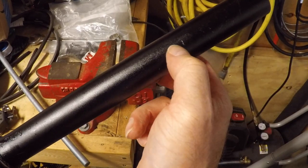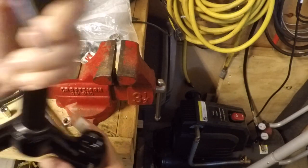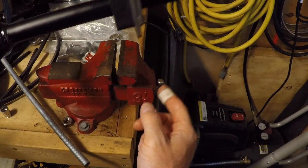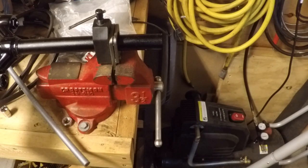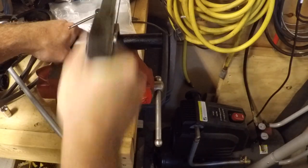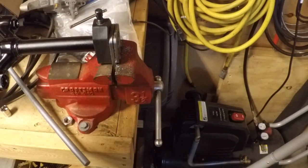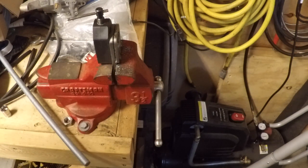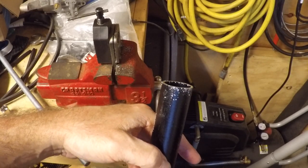Right here is our mark — that's where I'm going to cut. I'm loosening this to slide it down. I've got it in place. You put this end in a vise, so now your fork is well supported, and we're going to cut this baby. All right, that's that — tell me how nice that worked out. I've got a nice clean cut. All I'll do now is clean off the burrs, maybe get a file and touch it up a little bit, and then we're going to go and install this.